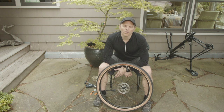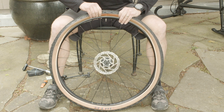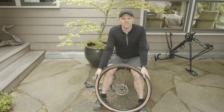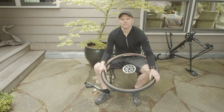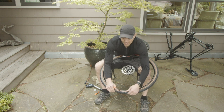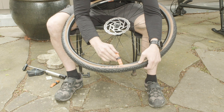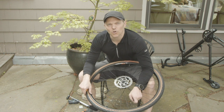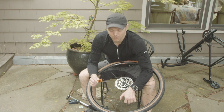Getting the tire back on the rim with or without levers — same thing as when we were taking it off. I'm going to push this valve back up, pinch the center bead of the tire together, and try to work it toward the center of the rim all the way around. Same thing as when I took it off — and then right at the end I can just flop it right in there without using levers. If you do have it too tight, or your grip strength isn't there, or the tire is new and just not going on, it's at that end point where you might have to use a lever to get the last little flip to get it inside. If you do this trick for a vast majority of your wheels you'll be able to do it without levers, but I don't recommend going out without levers because if you really need them, you really need them.